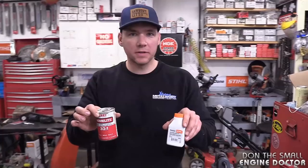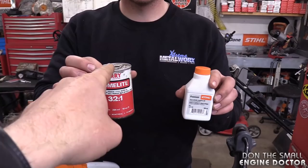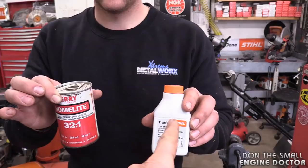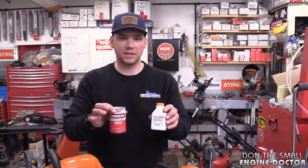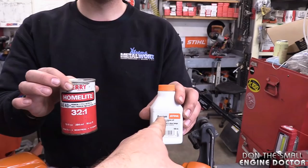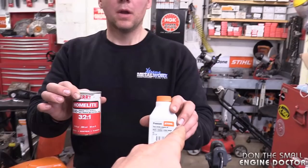Both of these oils actually mix really well in the gas — I've tried the old oil in gas before. The difference is the properties in the oil. The modern oil is specifically designed for two-cycle engines, while the old one could also be used in four-cycle engines — it wasn't designated as a specific two-cycle oil. The ingredients are much different, which is why you get the same benefits using less of the new oil.